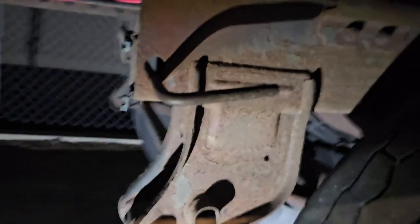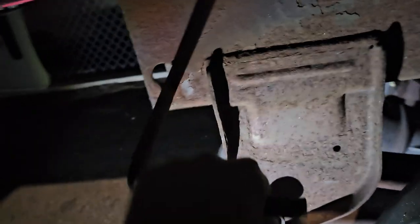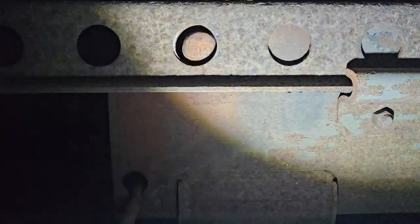This is the more common one you're going to see. It's right in front of the tires right here. I'm just going to reach in there, grab this handle, pull it out, and wedge it down. You can see there's a little hook there where it'll normally latch down, but this is an old rusty thing and it's worn out. I had to wedge my needle nose in there — it's got a little cutout — but when you pull it up, you can see that pin right there.